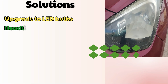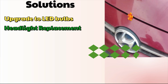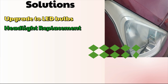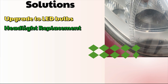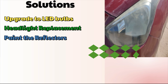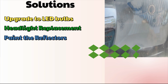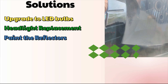The next option is to replace the headlight lamps. This won't cost much — for my Grand i10 it costs around 2,000 rupees, so for a pair at 4,000 rupees I can run the same headlights for at least five to six years without any problems. Another option would be to repaint the silver foils, but I don't think that's a feasible option — they'll charge around 2,000 rupees, and I can't guarantee the quality using the same spoiled reflectors.